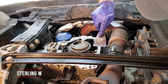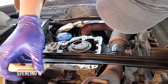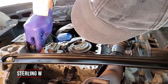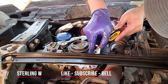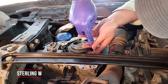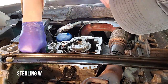This is my pet peeve — my 2017 Chevy Volt has 95,000 miles on it. I've heard the gasket material was bad on 2016-2017 Volts and leaked within the first 5,000 miles. A lot of owners brought it in for warranty repairs, but from reading forum stories, many continued leaking because the new silicone didn't get enough time to cure. With about 50% EV usage, the gas engine has roughly 50,000 actual miles on it.